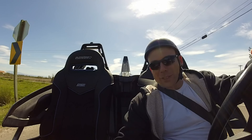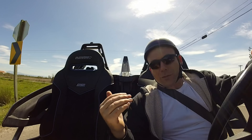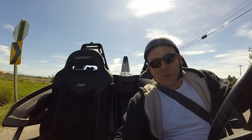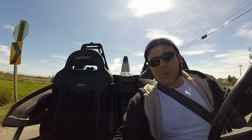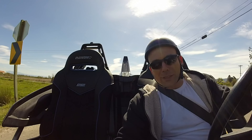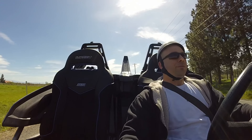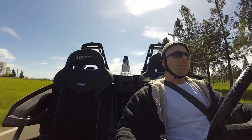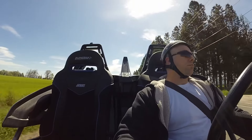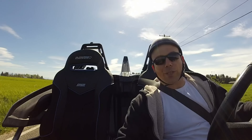What I've done here is stiffened up the rear shock and softened up the fronts in an attempt to get a little better weight transfer for launching. I'm not on a prepared surface and I'm using stock Kenda tires, so we'll see how it goes. This first time I'm just going to ease forward, let the clutch out, and floor it to see where the traction's at before I try to get a good launch. That obviously spun the rear tire still, but I did hook up sooner than before.